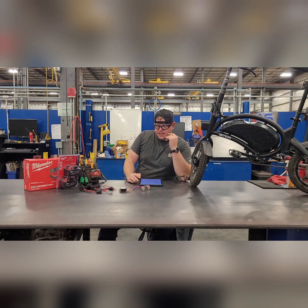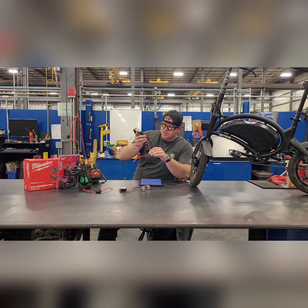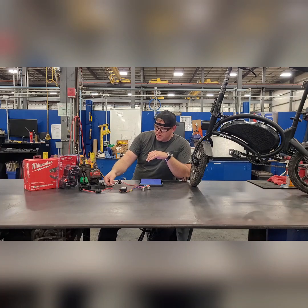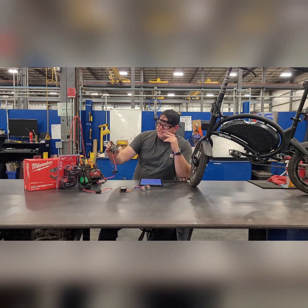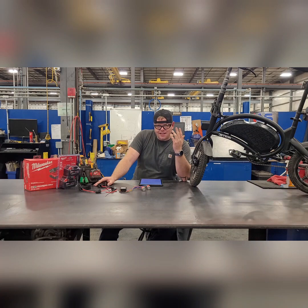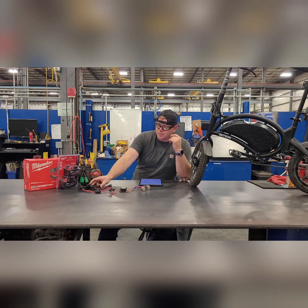Here's what we're using to accomplish this: we have the batteries and these Milwaukee battery adapters. This switch is going to be cut off, and we're going to run one inline fuse at 30 amps. This 10-gauge wire is rated for 30 amps, but we're actually going to step back down to 16-gauge wire in the circuit, which will still handle all the power we need. I went with injection-molded adapters rather than 3D-printed ones — the problem with 3D-printed ABS plastic is the temperature threshold. On a hot day sitting in a car, I don't want it deforming or melting.